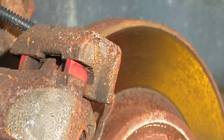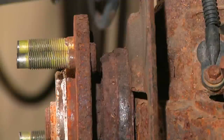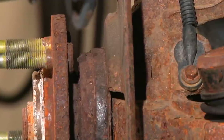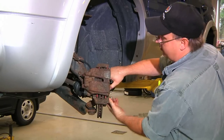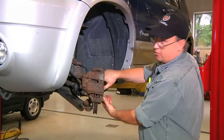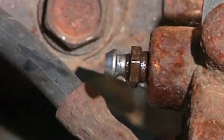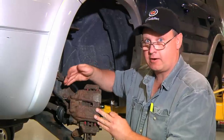So first I'm going to have my compadre put some pressure into the braking system. We'll notice the pressure as soon as he applies the brake — I will not be able to turn this wheel. With the brake not applied I can turn this wheel fairly easy as the brake caliper is not squeezing on the rotor. As soon as my compadre applies the brake I can no longer spin the wheel. As soon as I have hydraulic pressure in the system I'm going to open the brake bleeder to let any air out of the system.